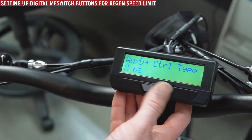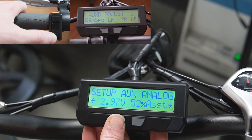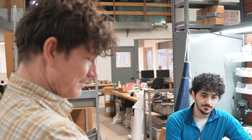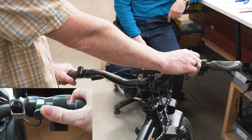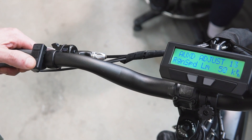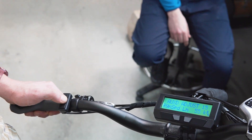For digital we're going to do the two-button control, and the function is going to be the regen speed limit — I'll set that at 55. The way Raz wanted his system set up, he actually likes using the potentiometer to control the assist level, letting him go from zero up to eight times assistance — meaning the motor does eight times more power than he puts in with his legs at full maximum. We've also configured the digital input to set a separate regen speed limit, so with the digital input you can go from 22 kilometers per hour up to 55 kilometers per hour. That enables automatic regen going downhill, varying and modulating to maintain a steady downhill speed — a quite handy feature for longer distance touring where you don't have to squeeze the brakes on the downhill; you just capture regen automatically. The regen cuts out once your speed drops below a certain amount.